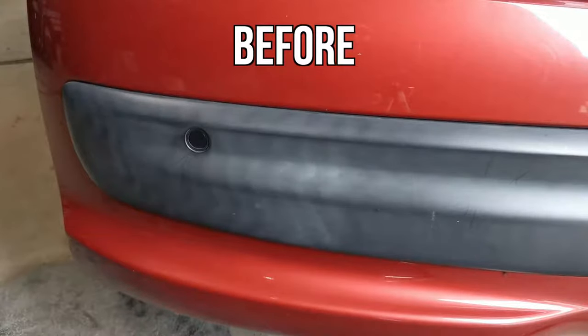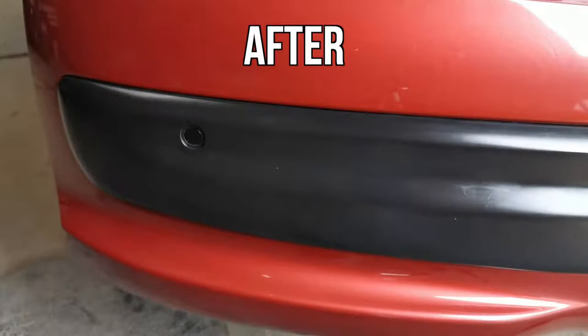So just a reminder of where we started from and where we've ended up — quite the transformation, I'm sure you'll agree. Just so you've got a better idea of how the process works, in this shot I've tried to get a close up of how the bumper transforms under heat. You'll see that as the bumper gets darker it spreads slowly as I move the gun around. This is that gradual melting process — the pores melting together going from grey to black.